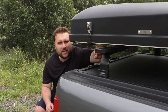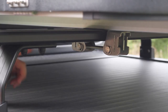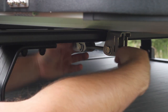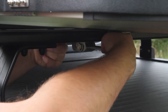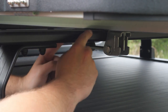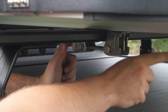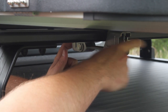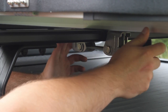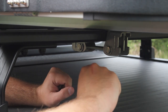Two thirds of the way there — we have the roller shutter and the bed bars. Now we just needed to get the tent itself mounted, and that provided a little bit of a challenge. On an iCamper 3.0, this is what the brackets look like. You access them with a big tool through here — it's just a rounded allen head — and then these two clamps come together and cinch on the bar. I knew these would fit because I'd seen various videos saying they were wide enough to clamp onto the bar. But we have a problem at the cab end — English pickup trucks aren't huge.